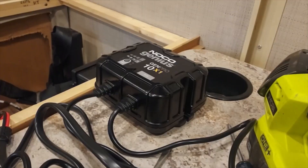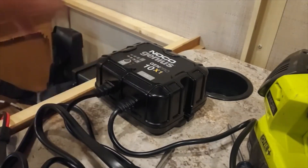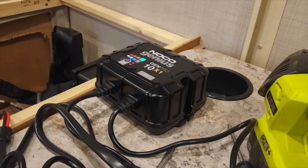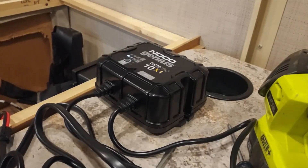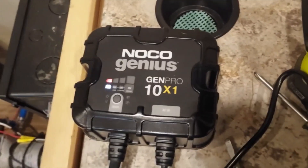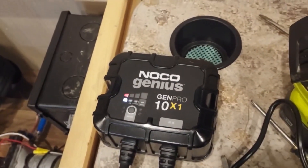You can see down in there we've got our ground wire securely fastened. So we're back online now. We've got to unmount the old charger and unplug it, then plug the new one into the extension cord. Before we mount it, let us show you how it works. Here's the mode switch — the first time you use it you have to set the mode for your battery type. It does have memory. Plug it in — you can see it's saying 12-volt battery, which is what we've got. You can see it's charging. When she's fully charged she'll go to the green indicator at the top.